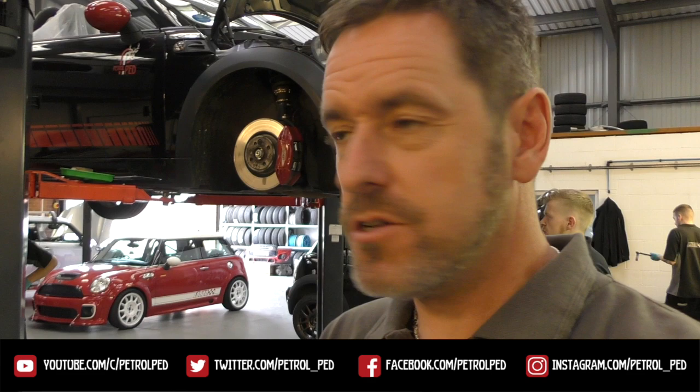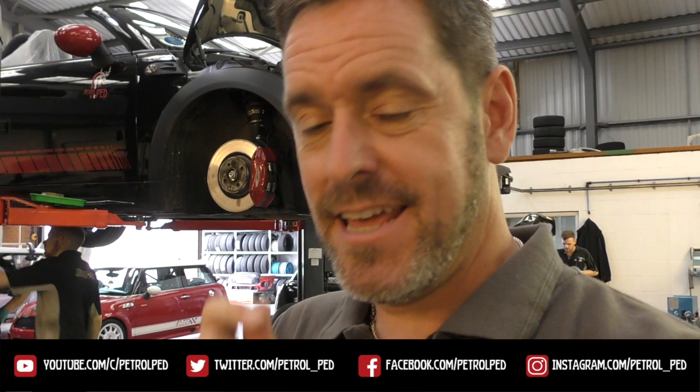Okay, so we have completed quite a lot of jobs. So diff in, clutch in, Powerflex bushes in, Mintex pads in, an auxiliary belt changed because the one that was on there had a bit of a hole in it. What we're going to do now is, these guys are absolutely expert at setting up minis. And one of the things that they said when I arrived was, look, if that was our car, we'd change the ride height slightly and put a little bit of rake in the car.